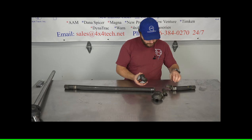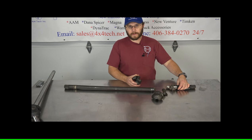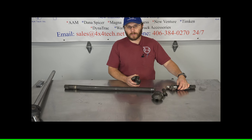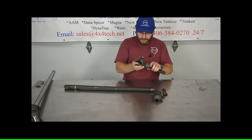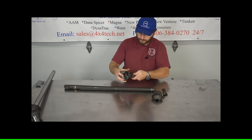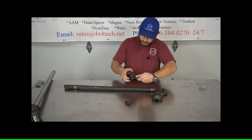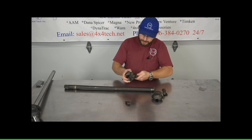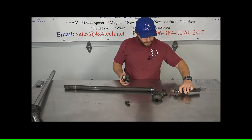However, it was a very weak system. For the trucks of the day, they were Dana 70 front axles. Dana 70 is pretty heavy, but the trucks only made 150 to 200 horsepower max, so they were pretty good for that. If you get anything more than that, they lose surface area when you're turning — especially when you're turning — and then they're extremely prone to breakage.